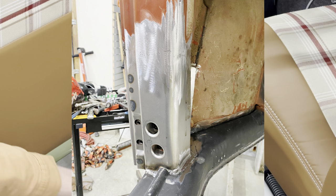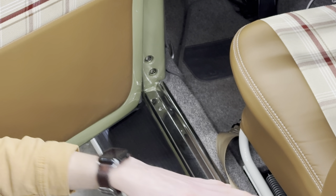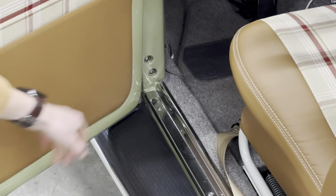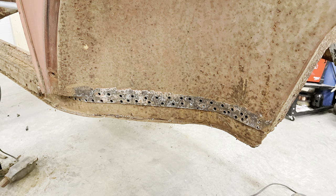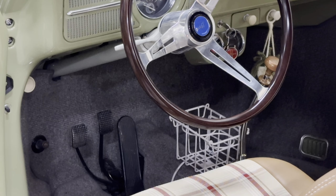That piece fully decides whether your door fits or not. And even then, after putting that much heat onto it and bolting the body down, something changed and the door doesn't fit perfectly — it's pretty close. Moving on from there, the other few spots I had to do: if you have a piece of metal and you're replacing it, check for spot welds. If it was spot welded in, you can take a drill and drill out the spot welds, then drill the same holes and weld through them — they kind of look like original factory spot welds.